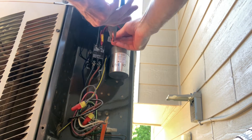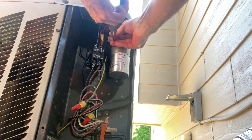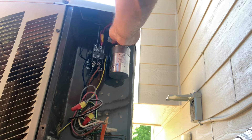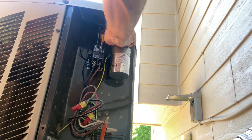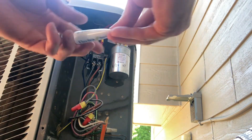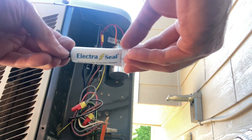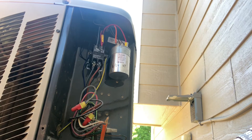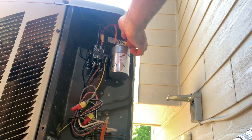I'm inspecting the connectors, making sure they're tight. This one felt a little bit loose as well. You don't need to pinch them really hard, just gently. Then put some dielectric grease on the terminals — you don't need a whole lot, just a small amount. It helps prevent or reduce corrosion in the future.